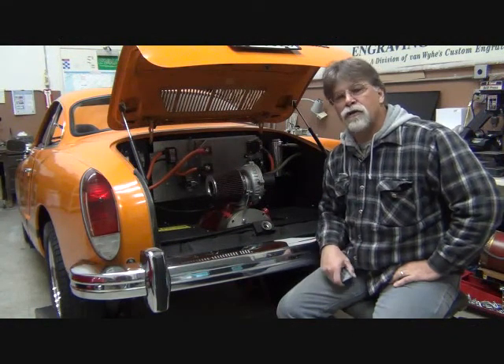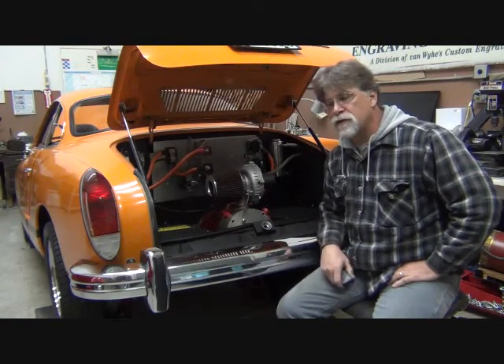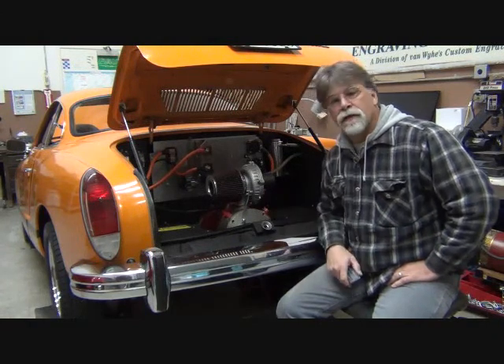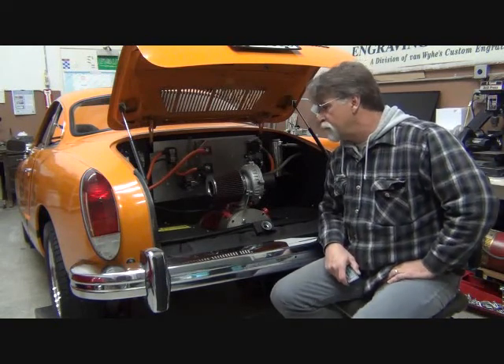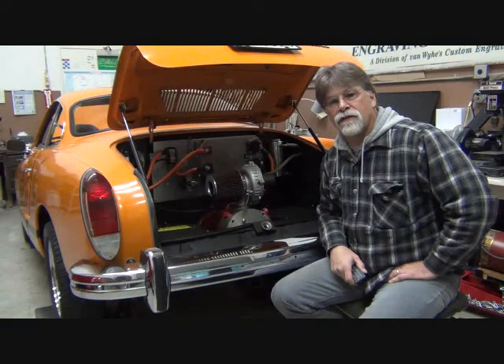Hello, I'm Richard with EV4U Custom Conversions and welcome to another episode of the Karmann Ghia Repairs, Maintenance and Improvements Series. If you remember the last episode, we needed to disconnect the shift linkage from the transaxle. Our immediate goal right now is to remove the transaxle because we're replacing it with a rebuilt one. We removed our cells from the battery pack to get access to that coupler so we could disconnect the shift linkage from the transaxle.